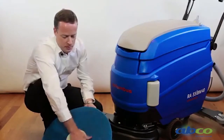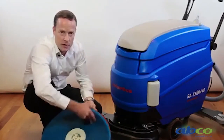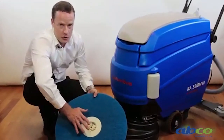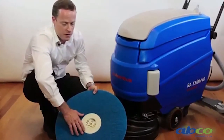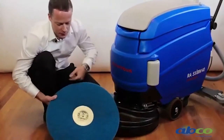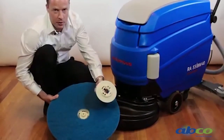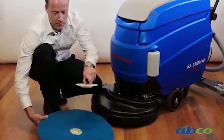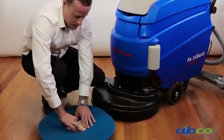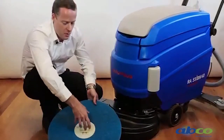With the pad, this can be cleaned and hosed off. Once it wears a bit, you can turn it over. To remove it, we've got a centre clip here. Now, there are a few different style clips — one option where you just need to unwind it, like a screw clip. This one here has got a different type of clip arrangement where we pull those pins in and then the clip pops off. To re-attach it, it's a matter of just pushing it on and it'll clip into position. Please note there are a few different types — you may end up getting the one that's a twist clip.